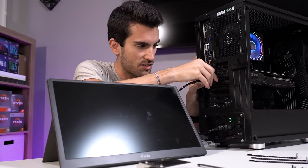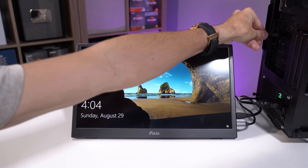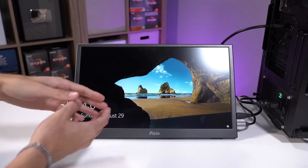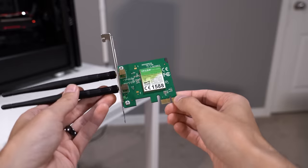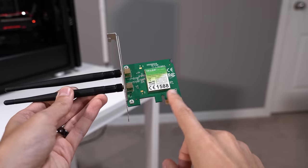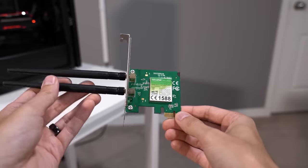If you remove that connection and slide the cable back into the original HDMI port, you can see we have a picture again. It's because the graphics card drivers haven't kicked in yet — so it's not like you can run multi-display right in a post screen or your BIOS, because the drivers haven't initialized for this graphics card. If you switch that connection to another display output connector without restarting the system when all you're trying to do is get into your BIOS, you get a black screen like this. Once Windows has been loaded into through the boot drive, when we switch HDMI ports now we should still get a picture — and that's because the graphics drivers have already initialized. You really shouldn't have a system adding a Wi-Fi card cause this kind of trouble. One of these can come in very handy, especially from a name brand like TP-Link, and don't let this single event scare you away from them — they're actually a really good solution if you need wireless connectivity.